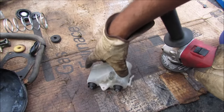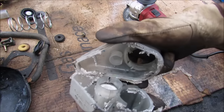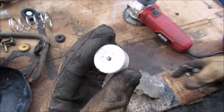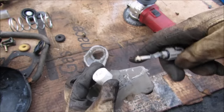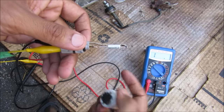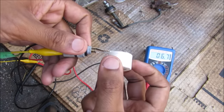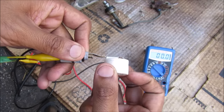Now I'm going to chop open the brake reservoir to see what's inside. This is the float on the inside — it has a little magnet that can move up and down with the level of the fluid, which causes the reed switch to turn on and off depending on the level. When there's no magnet nearby the reed switch reads open circuit, but when a magnet comes down close to it — i.e. the fluid level drops — the resistance drops to zero and it becomes a closed circuit.